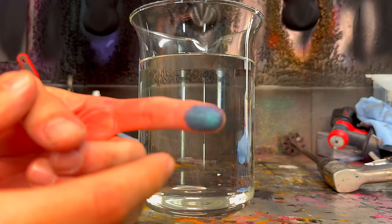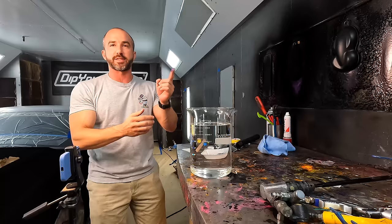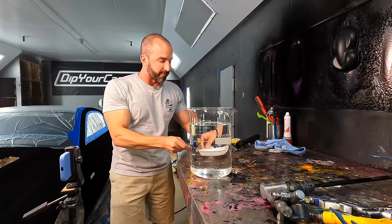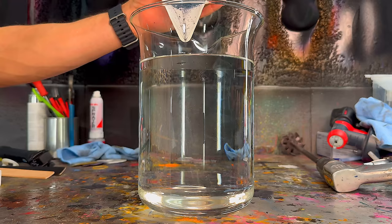And don't be deceived. I know it looks a little bit green, a little bit blue, but Gabe, what does this thing shift from? You got purples, blues, greens, ambers, coppers, pinks. It goes all over the spectrum. So we gotta be very careful with pigment load. We're going with just about 5 grams of ZTH per gallon of thinner.